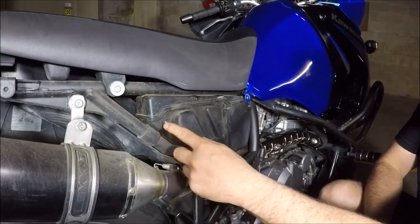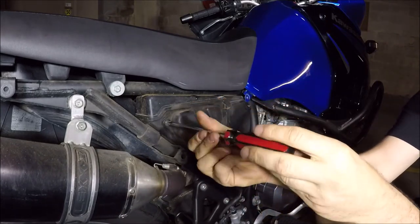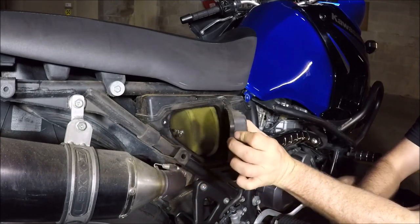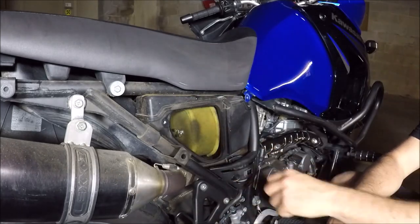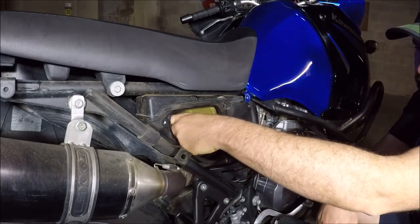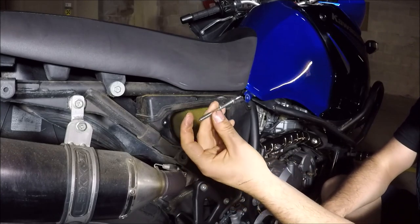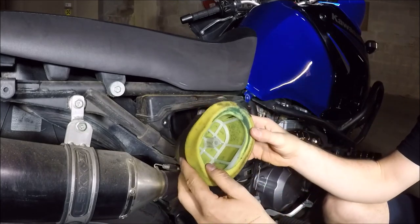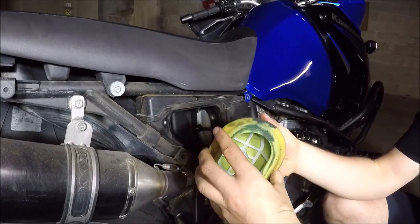With the plastics now off, you'll see a Phillips screw just in the middle of the bike between the tank and the exhaust. Just unscrew that, take it all the way off, and put it somewhere safe. This should just open and pull off. You'll see that's pretty grubby — we're going to clean that in a bit. And there is my old air filter. It's just got a wing nut inside; get that in there and start undoing it. There's the wing nut — then just pull the air cleaner off. It's pretty grubby and I certainly haven't changed it since I've had the bike for a year.